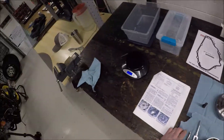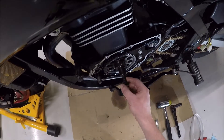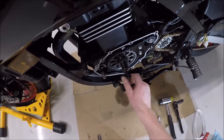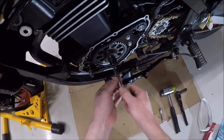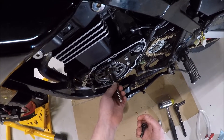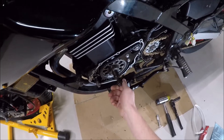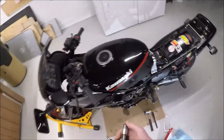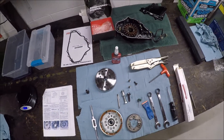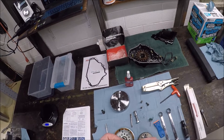Reusing the 6mm bolts. Now, about what happened with the bolt and why this took so much longer: I went to thread the left-handed 14mm bolt back in and no matter what I did I couldn't get it started. Using the flywheel puller had damaged just a little bit of the inside thread. None of my tap and die tools would work because I didn't have anything left-hand threaded. I had to wait for a left-hand tap to arrive. I cleaned up that initial part and now it threads in fine, but it put the project on hold for a while.